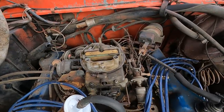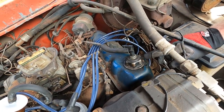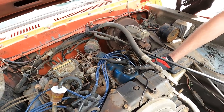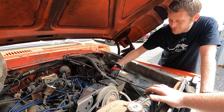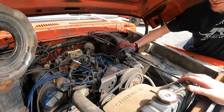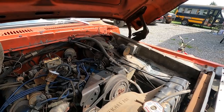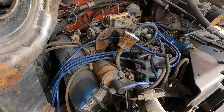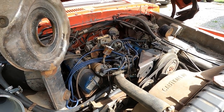And the difference between this, if you look at this engine, you'll think, oh, it's a 351 Cleveland, but it's the 335 series. It's what this is based off of, the Cleveland and the M series. The only difference is the block. This one has a 1-inch taller deck surface. Would you make it a 400 if you rebuild it? If you could find a crank. That's all, really, crank. Yeah, I mean, I'd put some better rods in it probably, but the 400 uses a 4-inch stroke, and this is a 3.5, just like a Windsor.